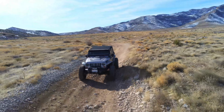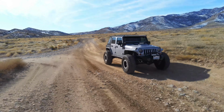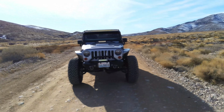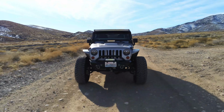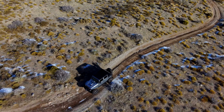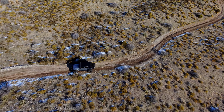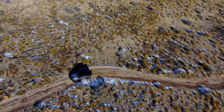The heavy-duty radiator and fan are not included in the $20,999 price. Again, being a high compression engine, my advice would be to buy as much cooling as you can afford. Getting the 52mm dual header radiator and the Camaro SS fan is going to ensure that you can crawl all day and not have any issues. On top of that, we have our rail coolers for the engine oil and the transmission, which is a little bit over the top, but in a Jeep like the one I'm driving right now, heavy on 40s, you might consider it.